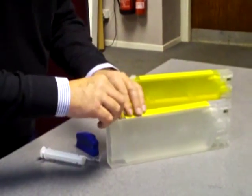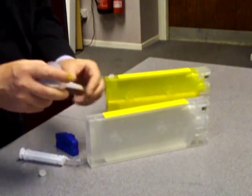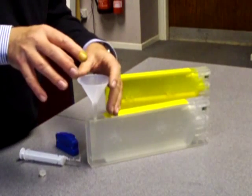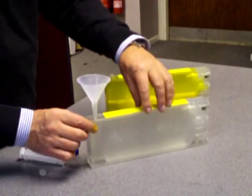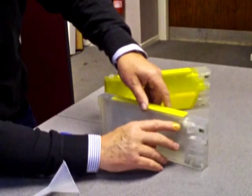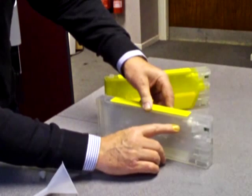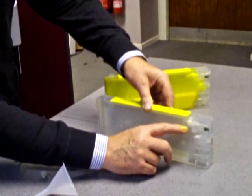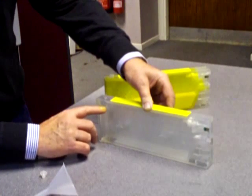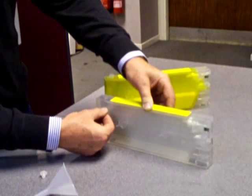All you need to do is take out the little stopper here. You're provided with nice little funnels — you get your ink and you pour your ink in here. The maximum height, let me turn it round so you can see, is around this level here. That little square there is pretty well the maximum height — about a centimetre down from the top of the cartridge is approximately the correct fill level.